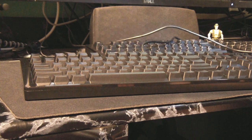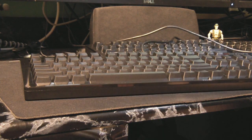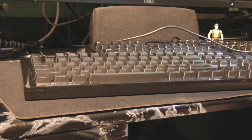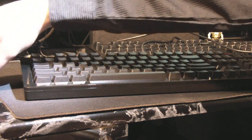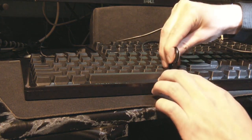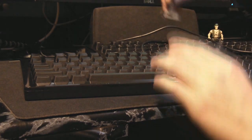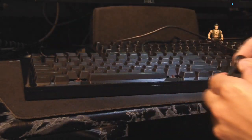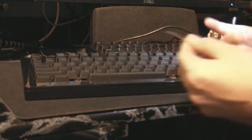So that if you ever have to do it yourself you'll have a good method. I'm trying to stay out of the camera the best I can. First things first, I'm going to do the spacebar because it'll be the easiest to see — it's also the easiest to do, so you might want to practice with that one. I'm going to pull off all the keys around it to make this a little bit easier. I've got the cheap generic key puller to pull the alt keys off, but for the spacebar I'm going to use my self-fashioned pullers.